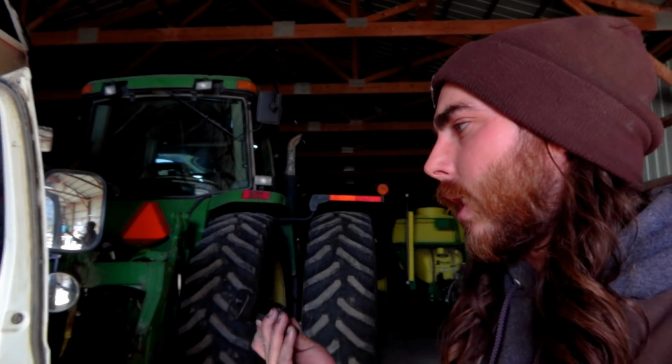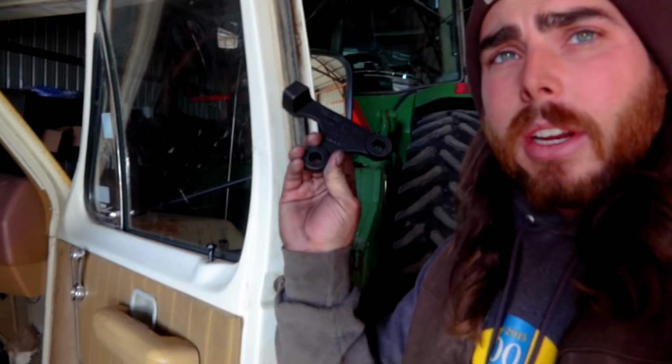All right, I'm ready to tell you guys about my secret weapon. I already gave a little bit of a hint in my last camper video, but this is called an exhaust manifold clamp. The 460 switched over to EFI, electronic fuel injection, I think in the 90s. And since this is a carbureted version, they didn't make them for the carbureted engines. That's just what it said online anyways. I took a gamble and got one anyways. The block part or the manifolds, none of it changed when they switched over to electronic fuel injection.